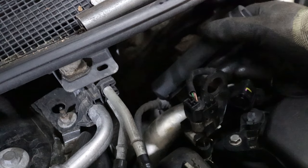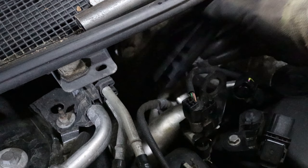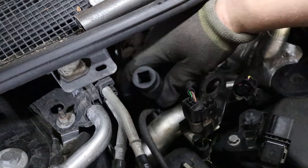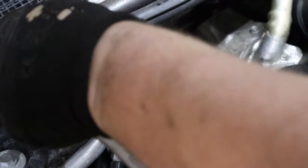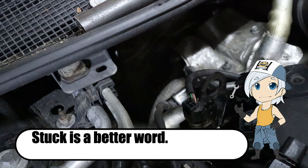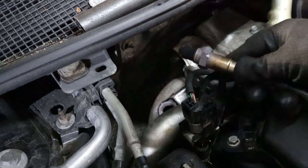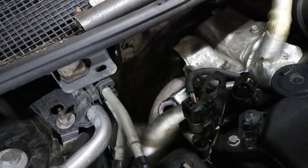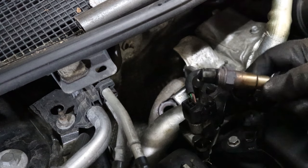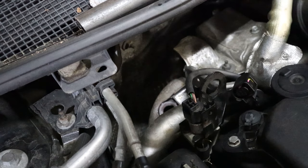The O2 sensor is located right here. What I did is unplug the connector, and now it's just a matter of getting that thing out of there. These things can be really tight. Never yank them around — these are really delicate. Don't hit them with chemicals or anything like that, just wipe them off, do nothing crazy, and set them to the side.